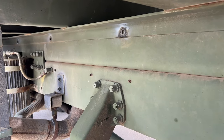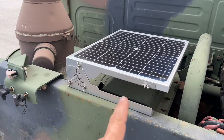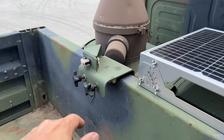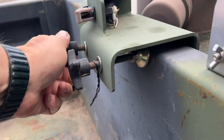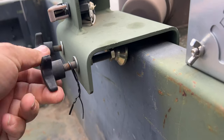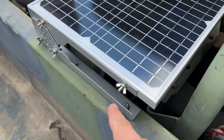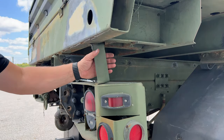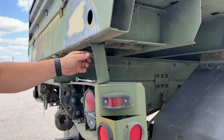Some of the bolts needed to be heated up to get the nuts off. There are two pieces of wiring I need to disconnect from the bed. I had added a 24-volt solar panel, and there's also the switch to alert the driver to stop — that one just clamps on so I can unscrew it and move it off the bed. Now I just have two screws to remove up here. For the small brackets, I have everything loose except one, but the weight of the bed is holding it and tilting it, so I can't get that bolt out either.